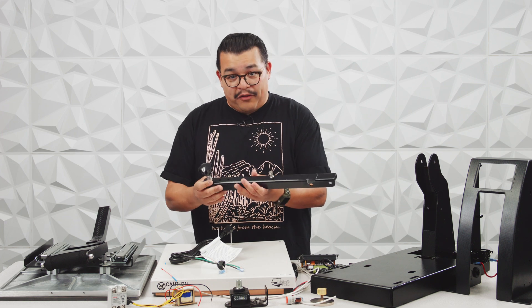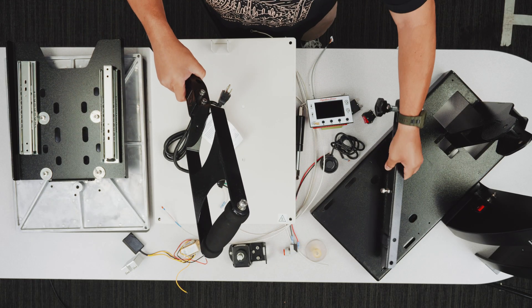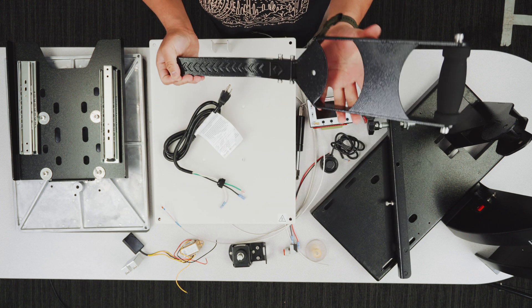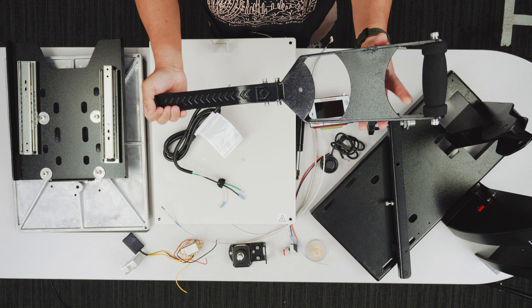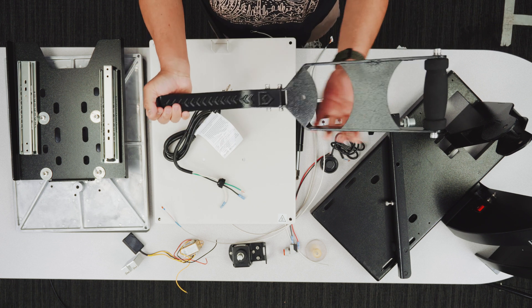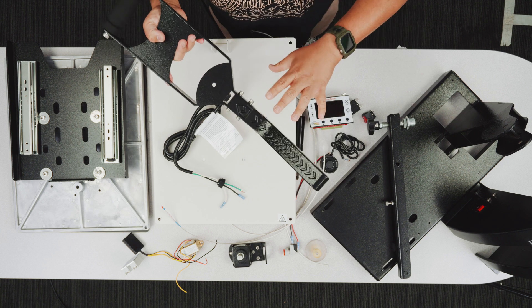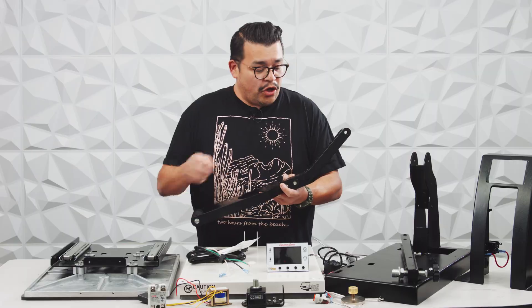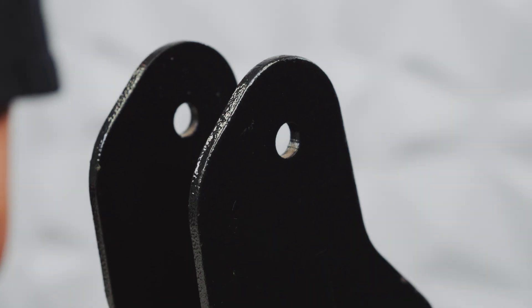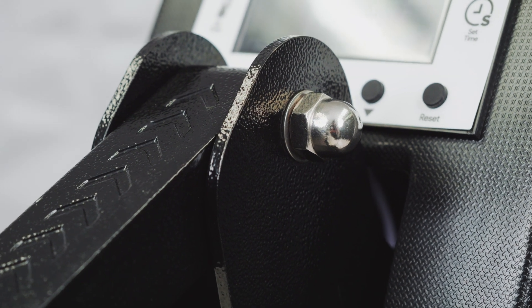This is part of the lever mechanism — the part you're probably more familiar with. Both of these work together and have to be built especially strong. This lever is where the transfer of energy comes from raising and lowering the lower platen and transferring that pressure energy onto your heat press. The joints that receive the most action and stress are outfitted with ball bearings to make the action super smooth and reduce friction.